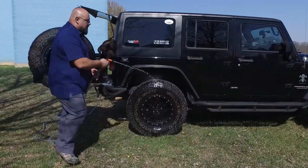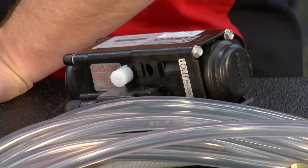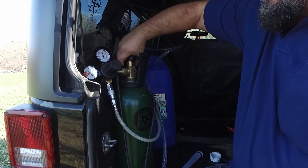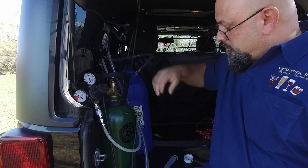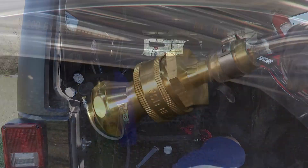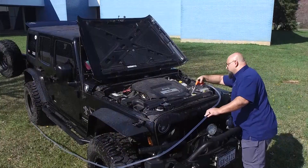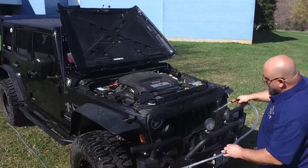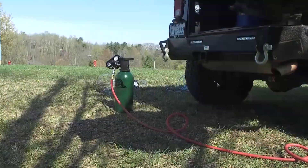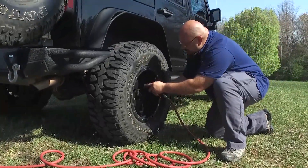There's also a water unit in this Jeep, and that's an extra you can purchase. The water unit uses a self-priming fluid pump powered from your CO2 system. You put a dip tube into whatever container you want — a six-gallon container is included, but it could be a milk jug full of water. You get a high-pressure spray with a garden-type fitting, so any squeeze handle you'd fit on a garden hose works. You can have a shower, a jet stream, a cone, or whatever. It's set at 90 PSI, which is plenty to run the water system, the air system, and a medium-duty air tool.